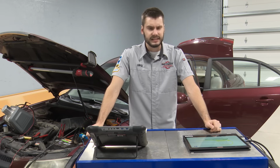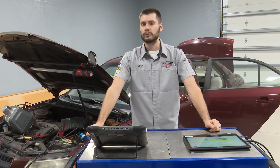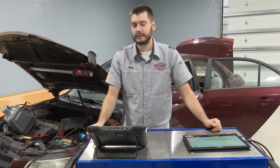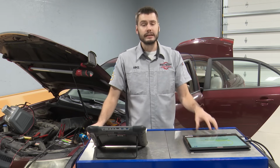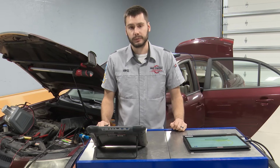If you're replacing a fuel tank pressure sensor, you have to disconnect it, right? If you're maybe doing some testing back there and you bump the connector and it unplugs, for whatever reason, what are the odds of any of those situations happening with the key turned on? Possible, right? I mean, accidentally we leave the key on and stuff all the time. It just happens. But any of those situations would have caused an open circuit, would have caused our P0453.